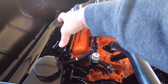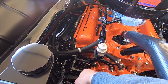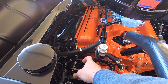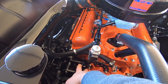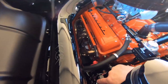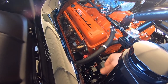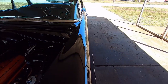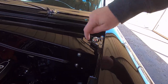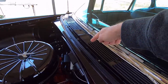I built my own bracket for the fuel pressure regulator and put a mid-mount alternator bracket on to get the alternator down out of your face. I took the alternator completely apart, decasted it — sanded all the rough cast smooth — used Z-chrome primer, then blocked it out slick. I drilled speed holes in it and put silver paint in the speed holes for detail. The rear brackets got speed holes and silver paint detailing as well.